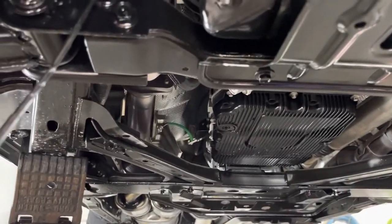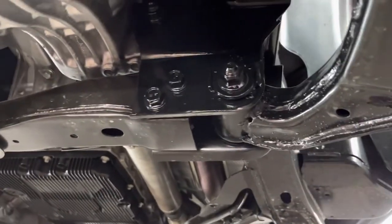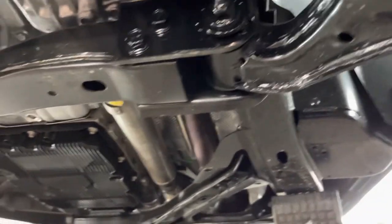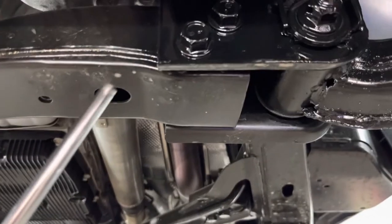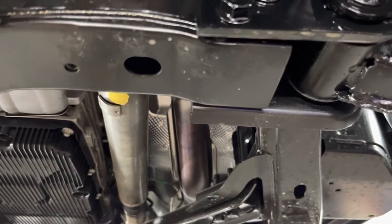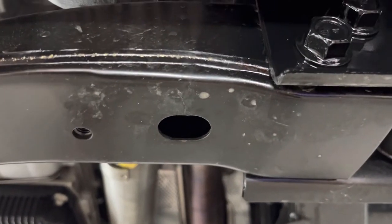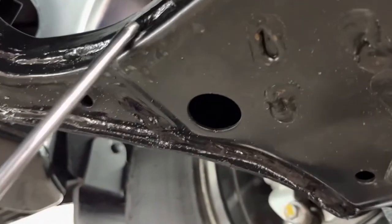All of these are just normal bolts but they don't have any paint on them. My experience living in Canada is that after one winter, everything is already starting to rust. Also, all of the welds — you'll see these spots along here — for some reason they're already missing paint. So I just paint over all the welds and give them a good shot of paint, and that will help my cause.